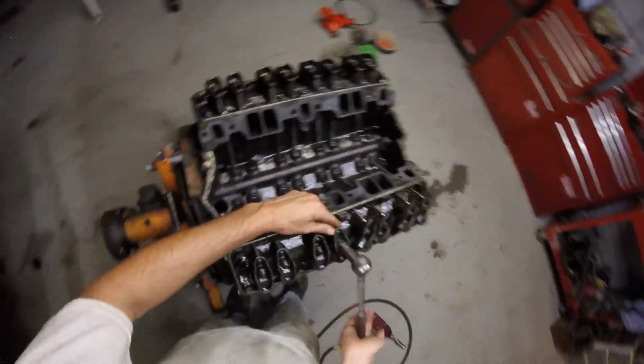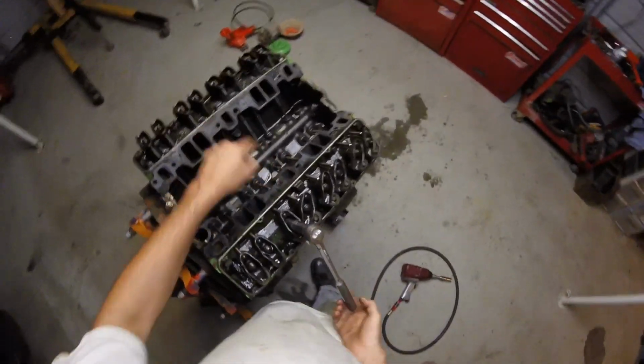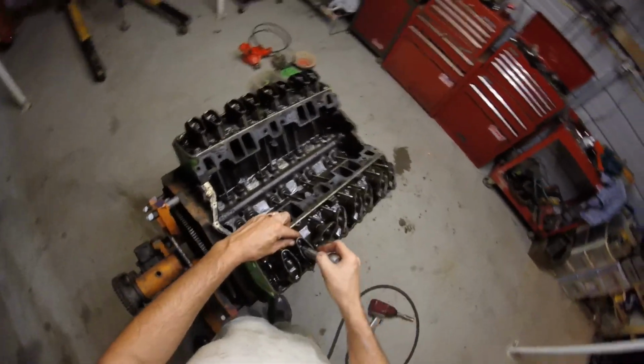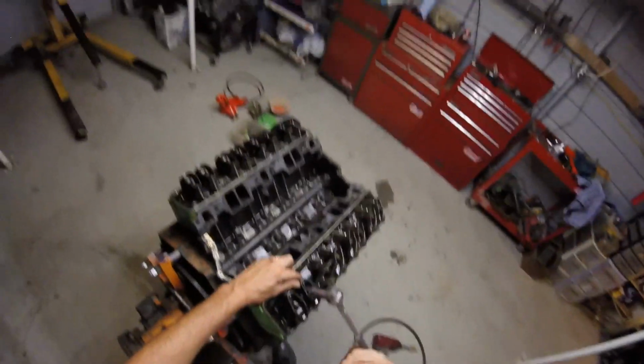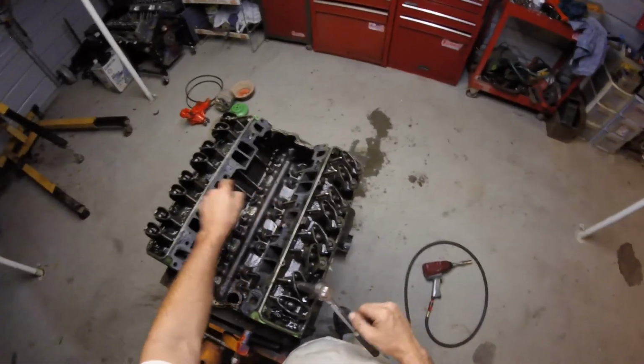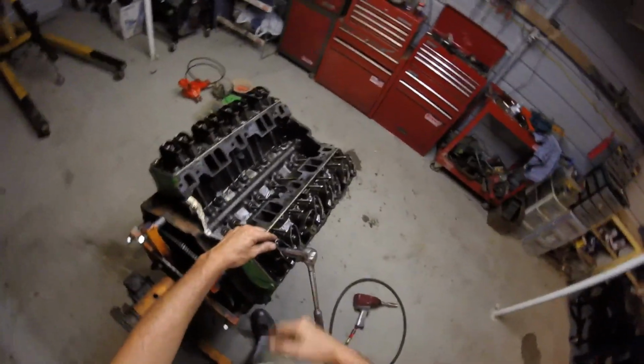Man, I'm so glad these are 487X casting heads. I don't know why, but these are one of my favorite cylinder heads. The only thing I don't like about them is that EGR crossflow deal with the exhaust valve on 2 cylinders. I'd like to take a set of these that I didn't care about and weld that all up, not so much here as in the bowls, and reshape the bowls to match the other 3 on each side.